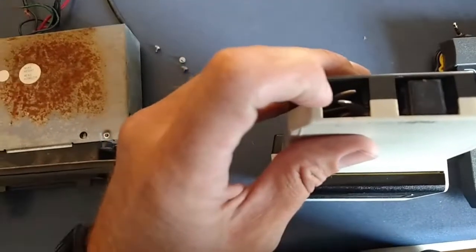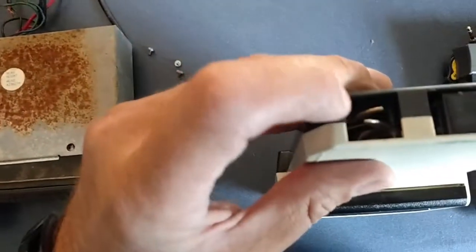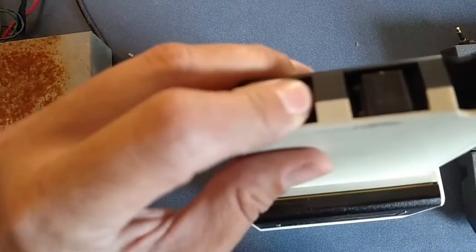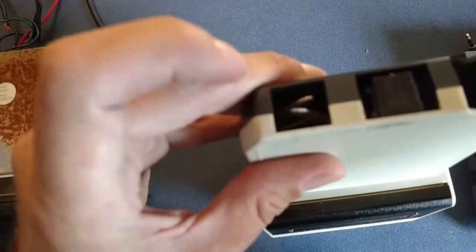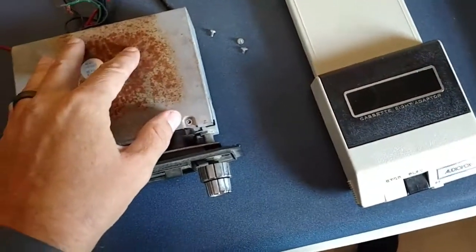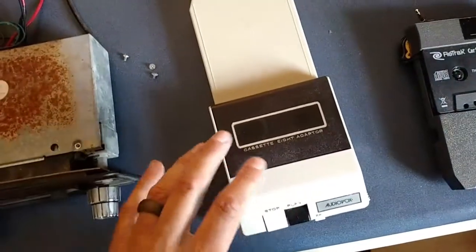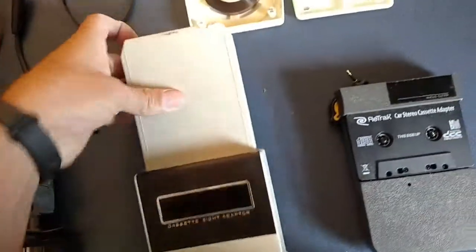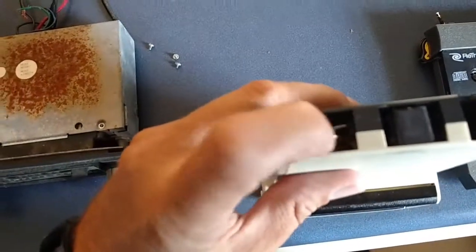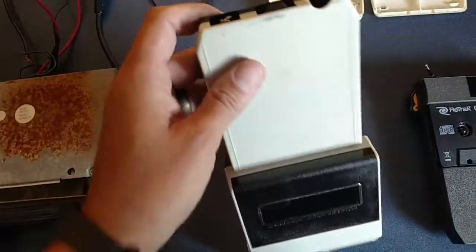The sensor that's inside the tape player has a prong, and this is also what powers the cassette adapter. I thought the mechanics that move the tape inside of the tape player also move the cassette adapter, but that's not the case at all. It simply powers a whole different drive system from these little spring-loaded prongs that go up against the sensor that triggers from the foil splices.